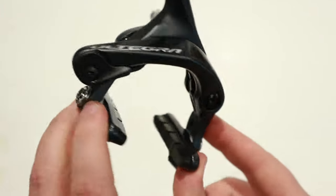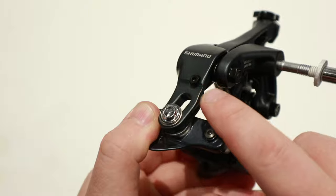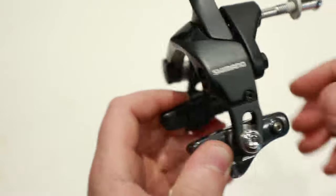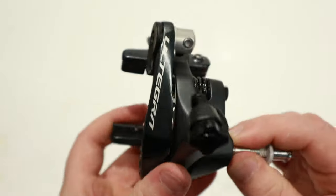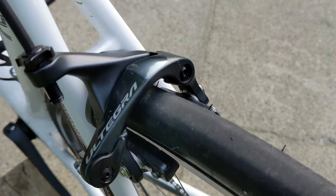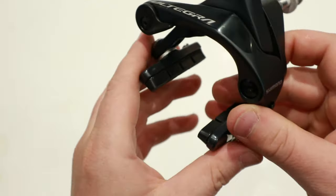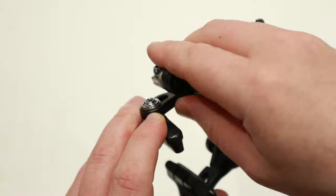To balance the two sides, you'll see that it just has one allen key, and that allen key is adjusting where that cam mechanism is to help balance which side of the caliper is pulling first. Another neat thing I really like is the release to be able to unload the cable tension, making it easier to open up the caliper and allow the wheel to come out. You can see that tucks up — the old ones used to tuck down — and that both makes for a cleaner look but it's also going to be a bit more aero.